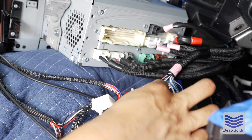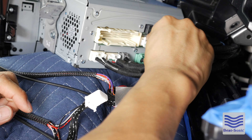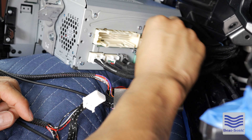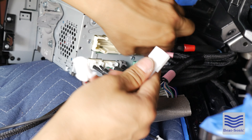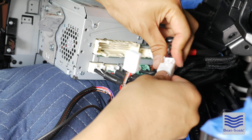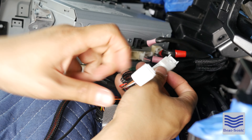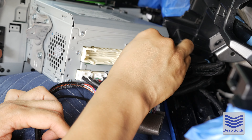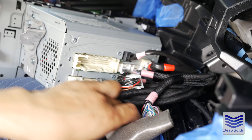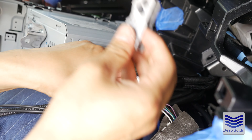Get in the driver's seat and mask off the surrounding area where this panel is going to be removed. After that, grab a hold of the panel on the bottom over here and just pull it towards you. Once you have that, disconnect the start button. Next, mask off this area over here with some masking tape and just pry this piece out.